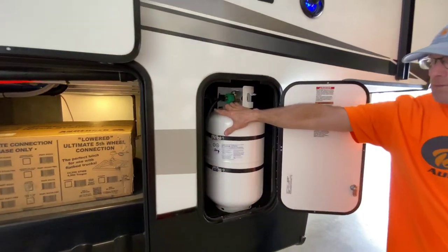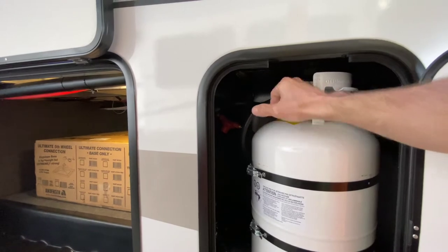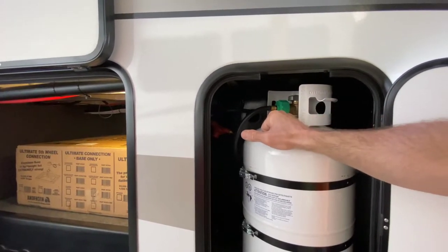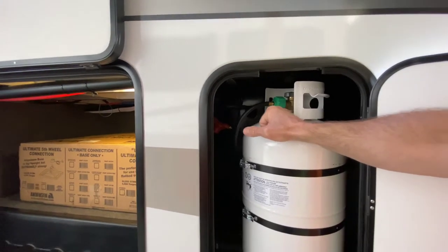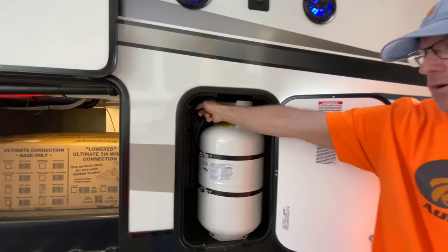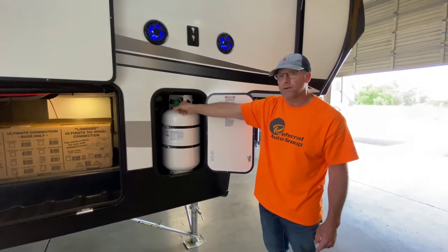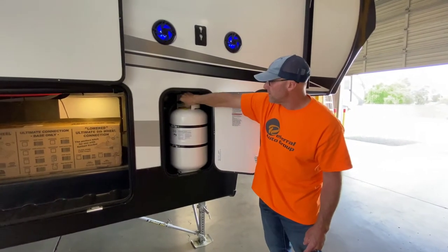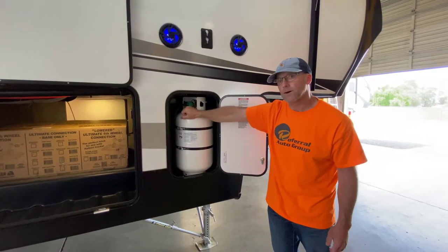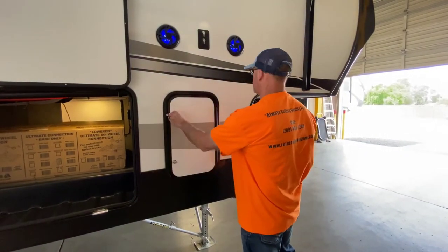It's a low pressure regulator, which keeps pressure against this hose when you first turn this bottle on, because the function in this valve is to shut down if it senses propane running too fast. This keeps back pressure against it. So when you open this and the propane fills the hose all the way to the other side to your feed regulator, it doesn't shut down in here. If it ever happens though, you can undo this. You're going to hear it release some pressure. It resets that valve, screw it back on. You're good to go. Two straps, and these come out very easily.